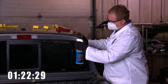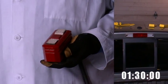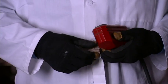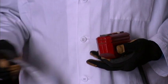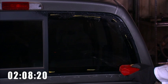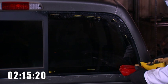As an insurance against overheating for beginners, we can spray a thermal gel around the glass or use a damp rag to keep the metal cool. The attachment is manufactured with a non-metallic tape to protect the glass from scratches. If your tape is damaged, you can replace it with any non-metallic tape or a replacement thermal tape we offer. Start where the urethane bead lies, with an arrow to the center of the glass, beginning in a corner and working 6 to 8 inches down each side.